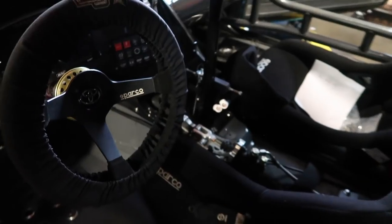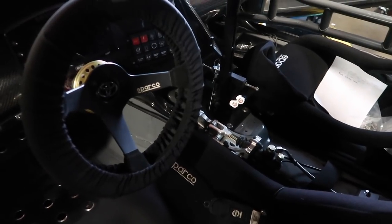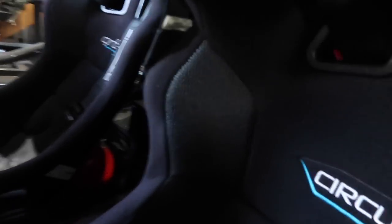I can't get this out until I take this off — we'll get to that later when I have multiple hands. I'm going to take apart the Supra because I need to get behind the dash. There's no way in there, so I'm just going to start taking stuff out, probably taking the windshield out too, because I need to get way in there to wire and plumb some stuff. We're going to run a nitrous line down from the bottle along this area here, past the driver or over the trans tunnel, going through the firewall with a bulkhead.